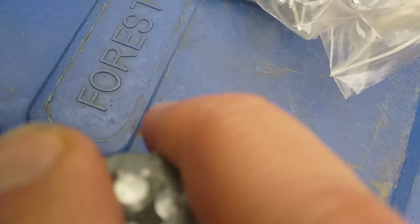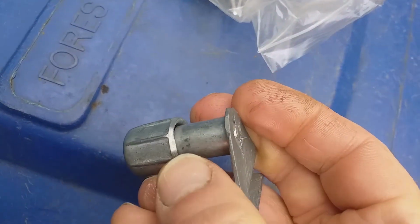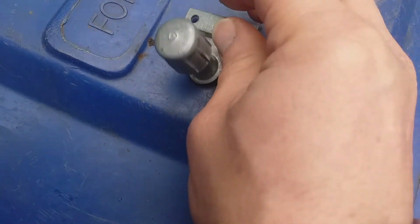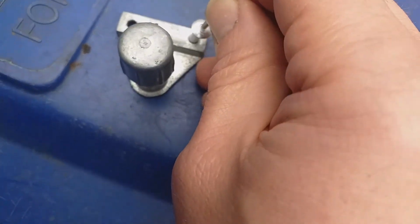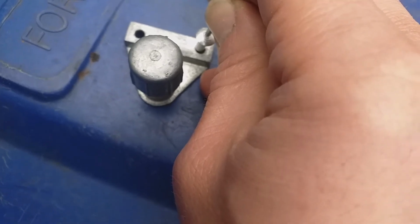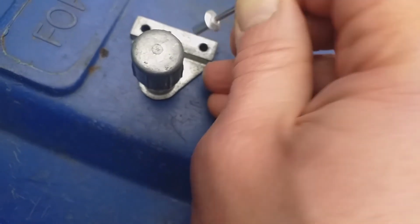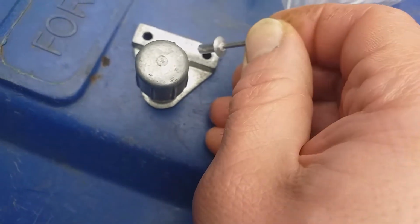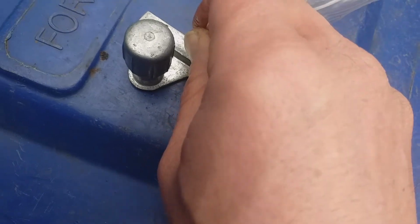Let's see if we can see the rust. Oh yeah. So I've packed that full of grease because it's obviously going to be a bit of a rust problem, potentially. Now, I said earlier we were going to use these pop rivets, but we're not actually, because they don't even go through the holes. Now the trouble is, the holes in the van do take these pop rivets. So 3/16, which is 187.5 thousandths of an inch, is the drill I used.